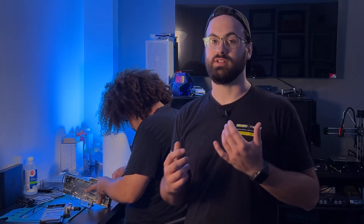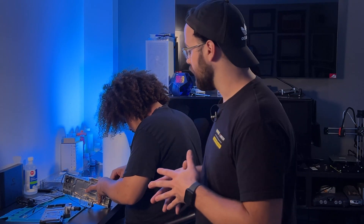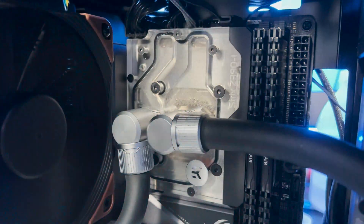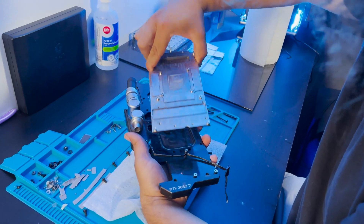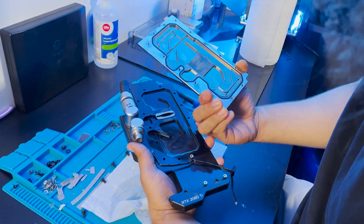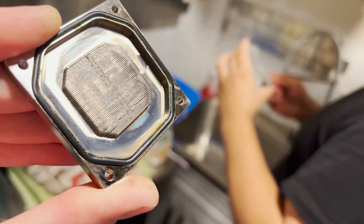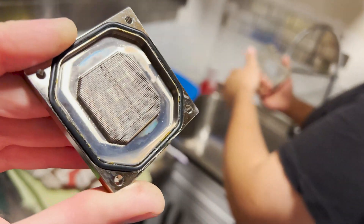That said, if you're using a traditional coolant — one that doesn't use suspended particles, or even just a clear coolant — you may be able to get away with just draining the loop, flushing with distilled water, and refilling it. Also, a quick note: now that we have the blocks open, some discoloration or oxidization isn't uncommon, but EK's own internal testing shows that an extremely thin layer of oxidization is not enough to have any significant impact on heat transfer through the block.